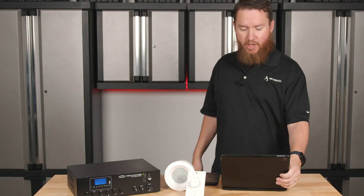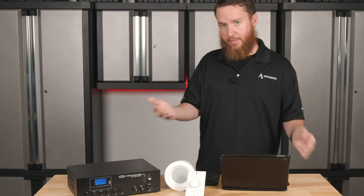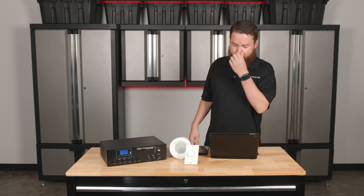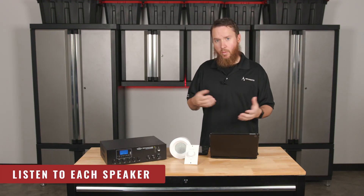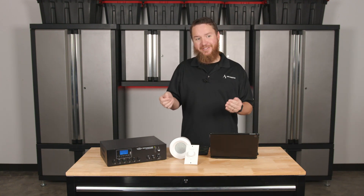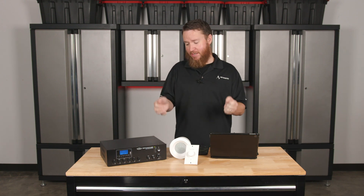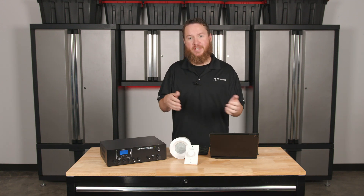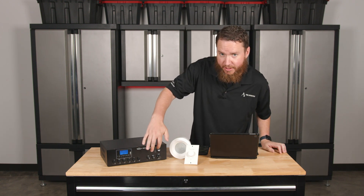At this point, this is when I normally turn on music so that I can actually hear the audio performance of the speaker. And at this point, we want to go and listen to all the speakers — do they sound correct? Do they sound the way we want them to? Are we pleased and happy with things? In a perfect world, the answer would be yes, and then we're done with this process. We've now successfully tested the system and we're ready to set the volumes to the appropriate levels, making sure we don't see any clip or protect lights.